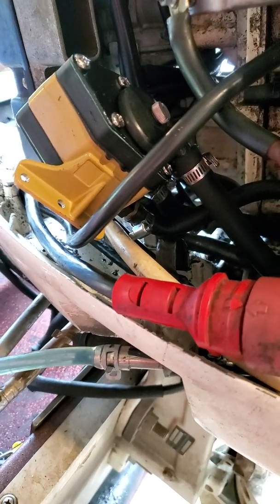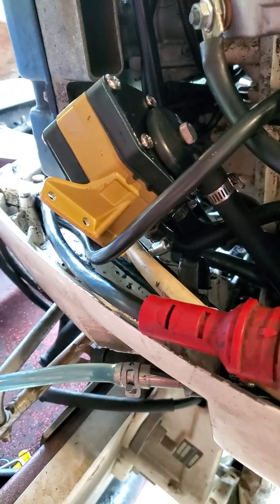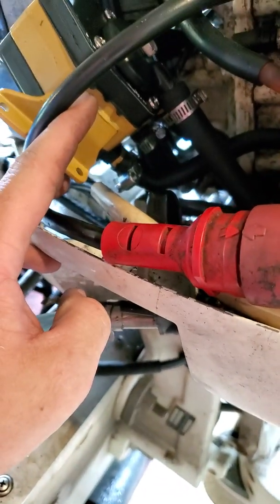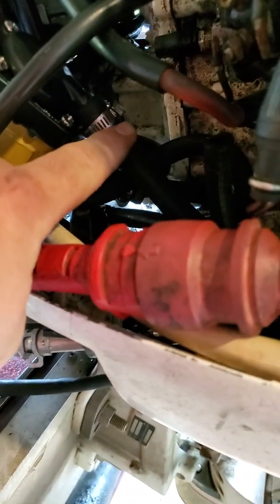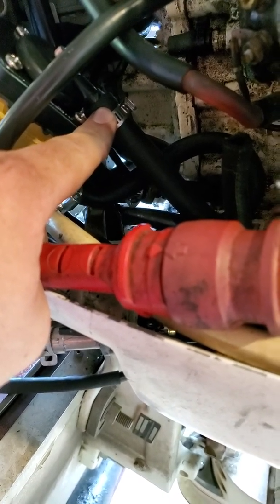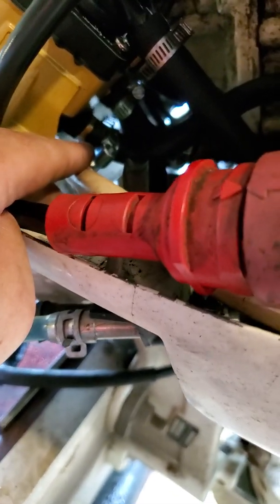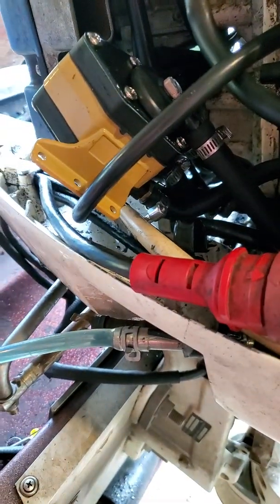But it did crank up. It's running at idle, I can rev it up on the stand. I have not put it in the water under a load or done any further testing. I just want to show you guys, since it was a little difficult to find how to plumb it — a little bit was trial and error. So: the plastic nib, the only plastic one on this side, is your fuel in. The middle one is your pulse, goes to the crankcase. And the far one goes to the carburetors from there.